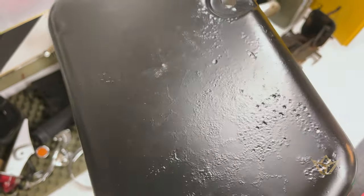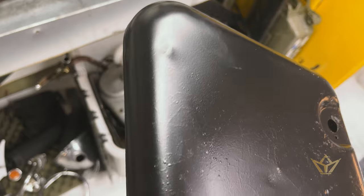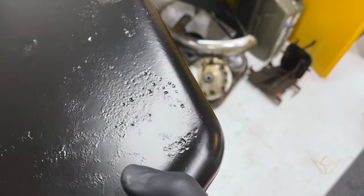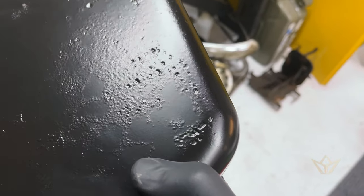You can see after the primer that we've got a few little bumps and dings in there. I'm suspecting these are from this little latch here, so I'm going to tap it out and then re-prime. We use a primer here — it's a thick pitting filler, auto-leveling filler primer, which is great because it means I don't have to put any filler on this. Let's get going.